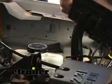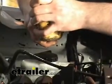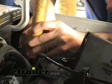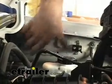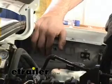We're also going to need to run a circuit breaker for the brake controller itself, which is the 30-amp breaker, so I'm going to go ahead and mount it side by side with this other one while I've got this area open. As you can see, I went ahead and mounted the two circuit breakers. This spot is actually behind the bracket that holds the fuse block, so you need to make sure to mark your holes and double-check your spacing so the circuit breakers don't hit the bracket of the fuse block after you install it. At this point I'm going to connect the black wire coming back from the plug to the 40-amp circuit breaker, then route the hot and ground from the brake controller up to the 30-amp breaker.